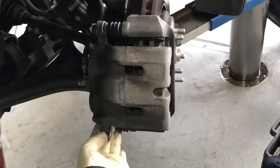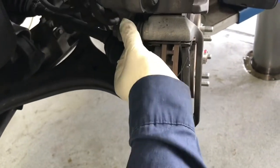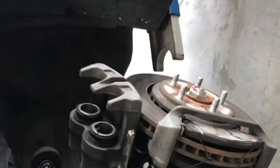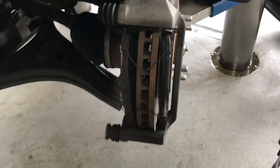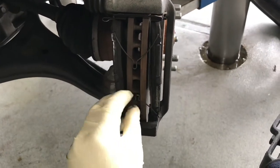That's the 17mm bolt. Then you can lift the brake caliper assembly and slide off the rubber seal right here. Remove the assembly like that and just set it on top of the brake rotor. Then you check the slide pin right here, making sure that it moves freely. These are the old brake pads and the old spring — remove those.